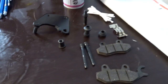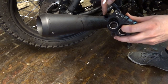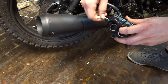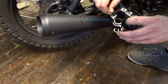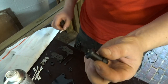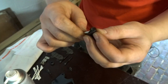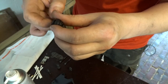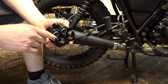Now that the brake disc is clean and all your parts are clean and dry, there are a couple more steps on the brake caliper. There's a little hole where a pin goes in — make sure it's totally clean, no dirt, no old grease. Clean it out. Also clean out the dust covers — they can be a little dirty. Make sure every single spot is clean and perfect.